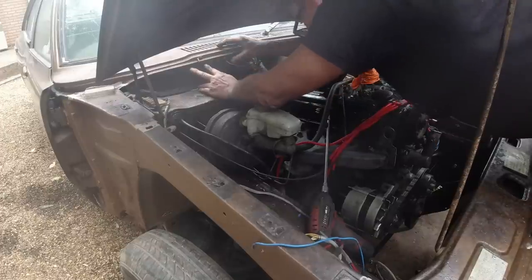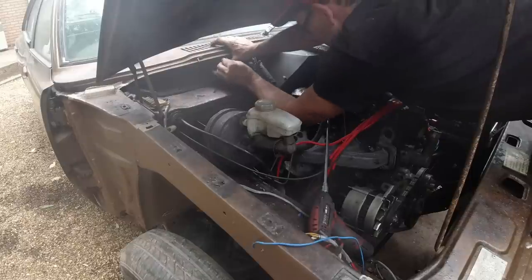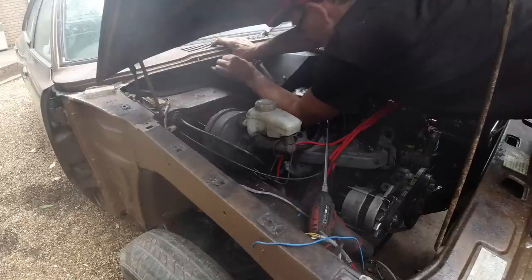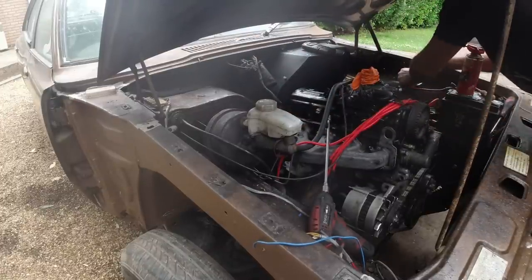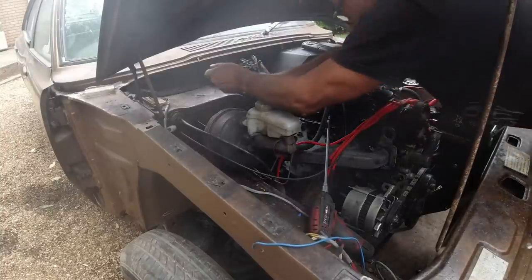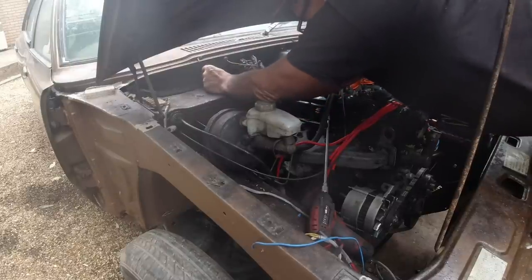Get that to start. That's the earth as well for the part of the circuit for the wiper. Don't forget your earth tab for the wiper motor. So this has to be squashed a bit more, simply because we've got fresh sealant, fresh sealing on it. The rest of the bolts are already treated, here in a little dish which was soaking in Fertan. Top one popping out, so we can't quite get the compression.